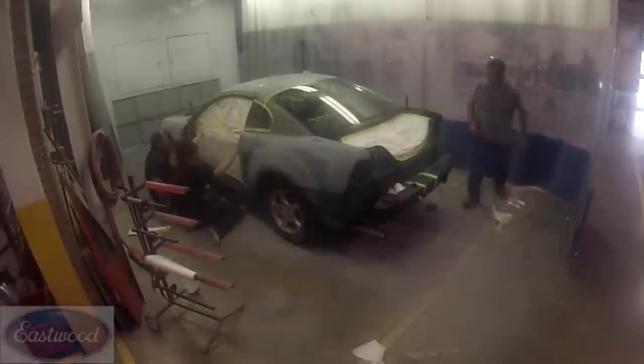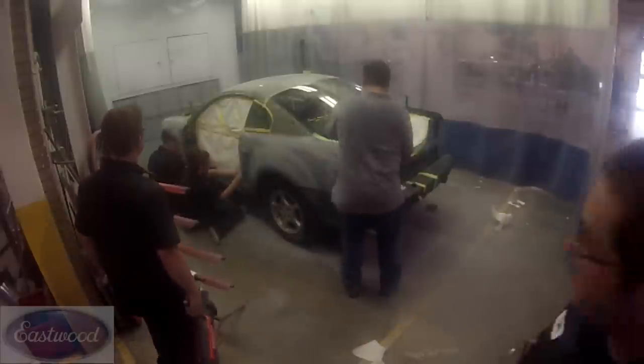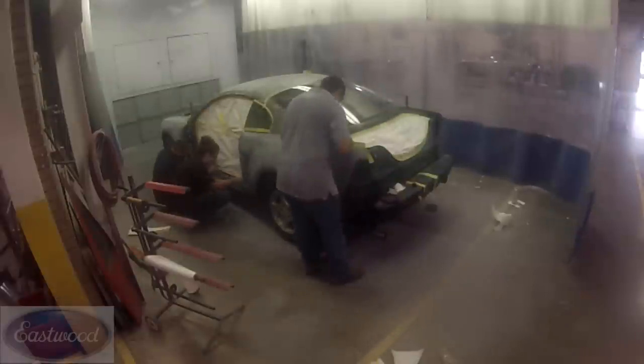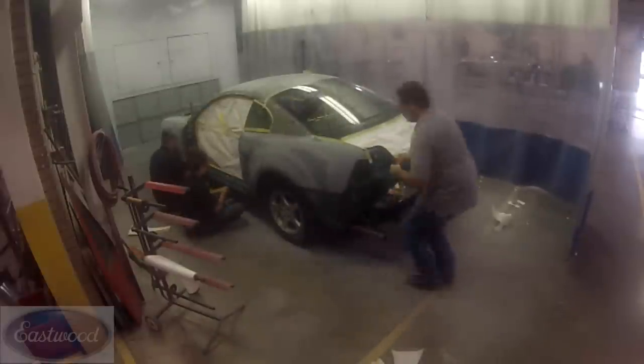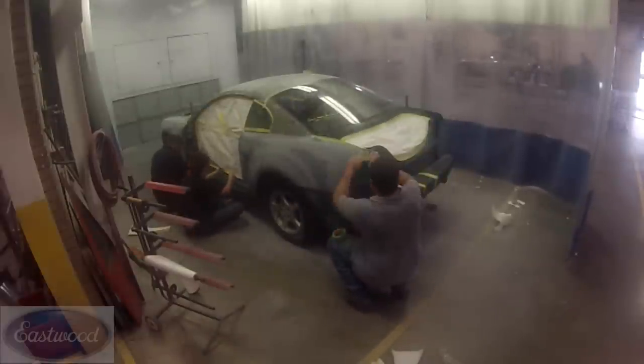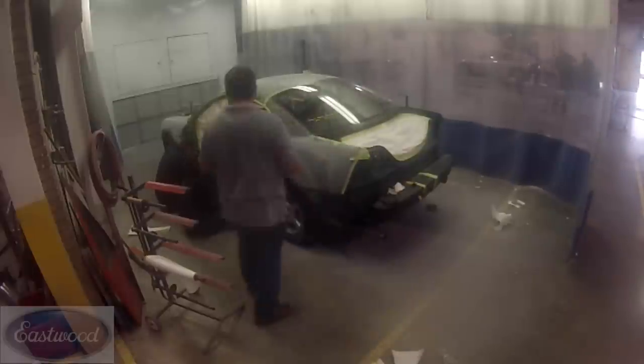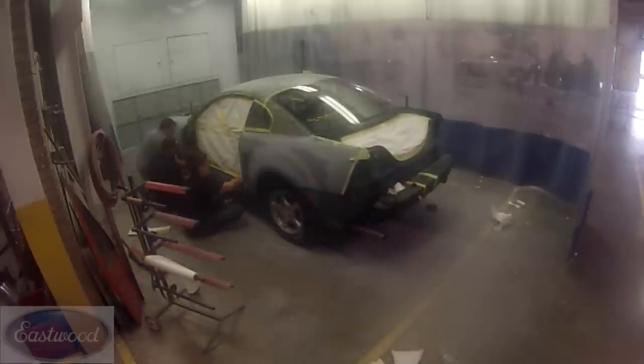Again, you can see that I'm wiping on it some more. I mean, you can never clean enough with paint work. It's just constantly making sure everything's clean, because you want things to stick good, like the tape, and you don't want wax or silicones, things like that. And you can also see that I'm coming to the edge of the panels and masking that as well.